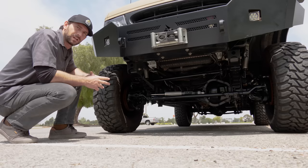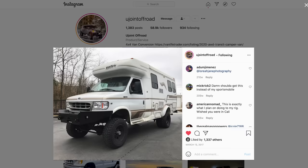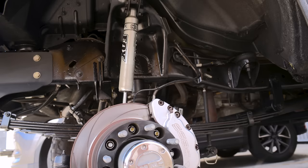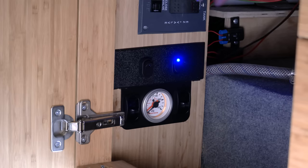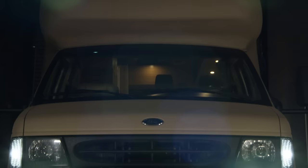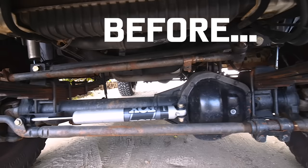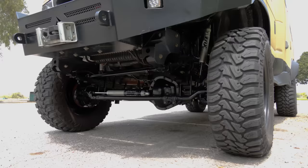When it comes to 4WD vans, the Ford Econoline is a great chassis because of the multitude of companies that make 4WD conversion kits. Starflight sports a U-Joint Off-Road 6-inch lift, the Dana 60 front axle, the SSBC big brake kit, and a NP271 transfer case. The leaf springs are custom made for the weight of the vehicle. In the back we added a Firestone Air Command 3 airbag system to help the rear — great for highway driving and when loaded up. The front and rear axle, frame, and other components have been hand sanded and we applied POR-15 paint for a nice finish and protective coating.